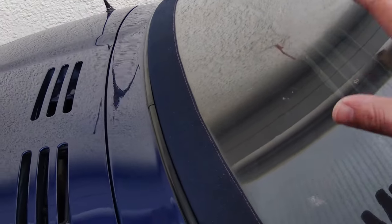Right, to service it, we need to get the back of the soft top up. I think there's about six or seven, I can't remember, clips along the back here. Fold it forward, take the engine cover out. I think there's 11 bolts that keep that in, and then we can crack on. So let's do it.